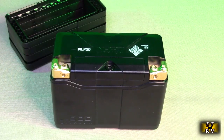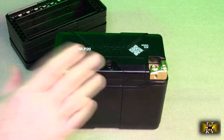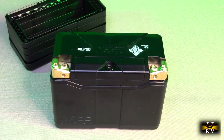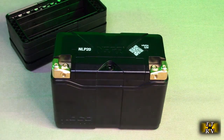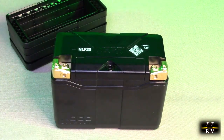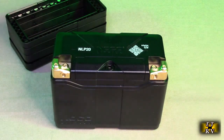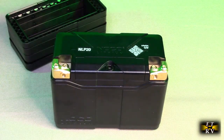As I said, it's 12 volts, 7 amp hours. What you want to do on Amazon is add your powersports vehicle to your Amazon garage so you get an accurate fitment. There's a listing of all compatible vehicles on the product listing itself. You can charge this a lot of different ways — we're going to show a couple. It came pre-charged at already about 13.3 volts across the battery. So this is better than lead acid in almost every way.